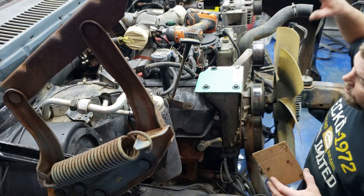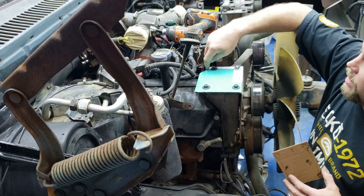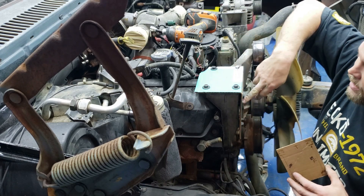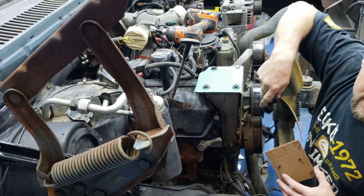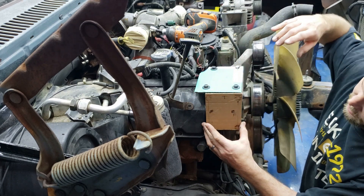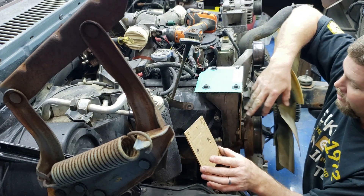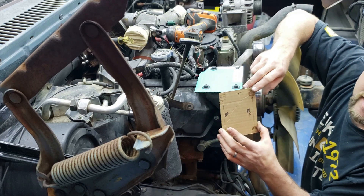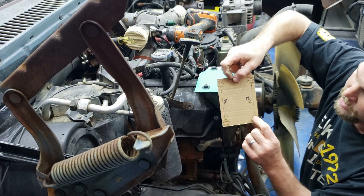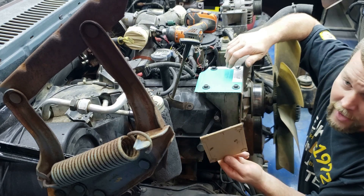So you get the basic idea of what I'm planning to do here — I'm going to make a plate for here and a plate for here, weld them together down this seam. I'll clean up the shape a bit, cut it where it's more form-fitting so it doesn't look so clunky and bulky. I'll also have to cut it to clear the tensioner. In case you didn't figure it out — there's a puddle of oil on the floor over here that dripped out of this thing, and I was dipping my finger in it and rubbing it around the bolt holes. That way it soaks in everywhere except right where the hole is, so I know where to drill. Kind of primitive, but it works.